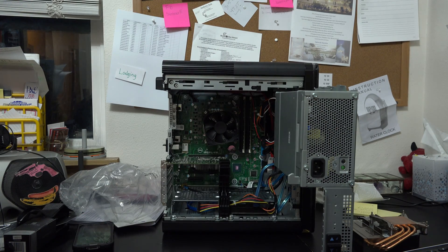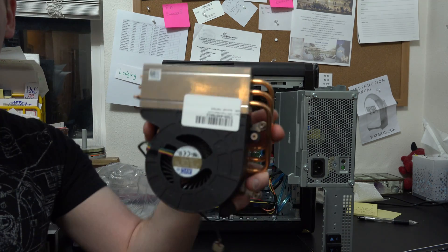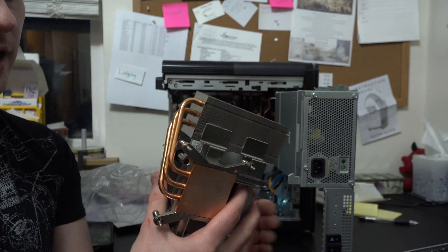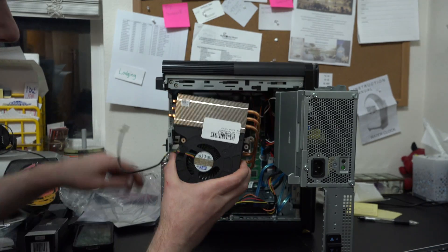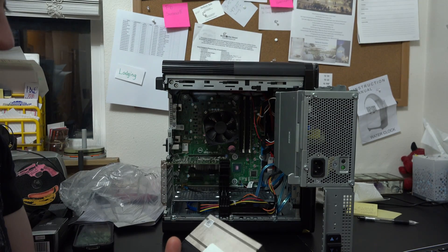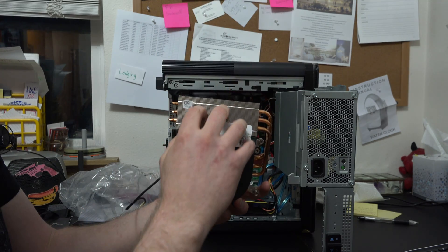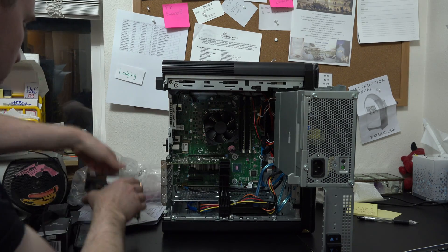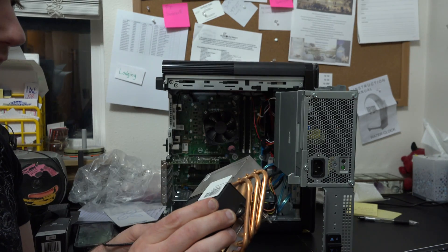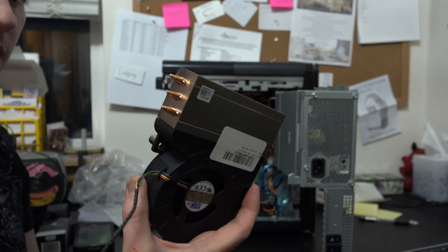Obviously eventually you could get a bigger case, and if you're going to do that you might as well upgrade the motherboard too. Luckily for us, Dell actually has a pretty easy option. They built this and actually put it in some of the 8910, 8920, and 8930 series desktop computers. As you can see, it will basically just bolt right in place of the existing heat sink and fan. It's got three tubes that go right up into this cooling section, and this fan pulls in air and blows it up through the cooling fins and right out through the top of the case, where there's another fan that helps pull all the air through. This is a great option. I got this off eBay for about 60 bucks — it's a factory option that Dell actually made for this computer, and it should really help to keep it cool.